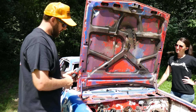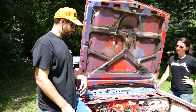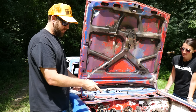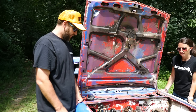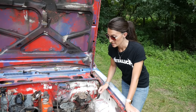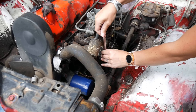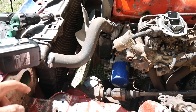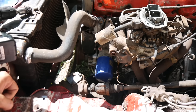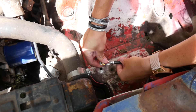I'm thinking either the wiring sucks between the two, or we do in fact have a weak ground. Easiest thing for me to do is just grab a big cable and smash it around to the head and bolt it to the body somewhere. I think we're going to do that and then we've got a full bonded path for the ground from the battery to the floor to the fender to the head to the distributor. And then we'll throw the old lightning whirler cap back on and please, baby Jesus, let there be spark. So we're going to take this from the intake manifold to the fender, basically because we're just really, really lazy and it's easier to go from here to here. The guy wants to keep his grounds clean, so I took the old electro-tonic screw gun with the wire wheel and got some bare metal showing there and cleaned that up as good as I can.